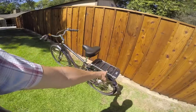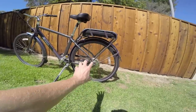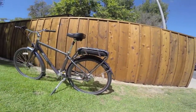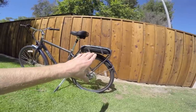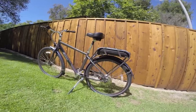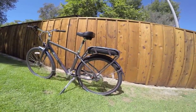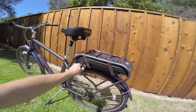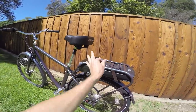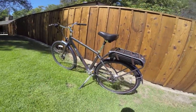There's even a 48-volt 15 amp-hour — the super deluxe option. The 48-volt 10 amp-hour battery pack weighs eight pounds on its own, and this is a rear-heavy design — hub motor in the back, the big rack, and the eight-pound battery up high in the back. It's not perfect in terms of battery placement, but everything else about the bike is so purpose-built and dialed in. I love that with the upgraded battery pack you don't have to leave the key in, which is an easy improvement especially if you're using panniers.